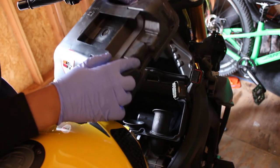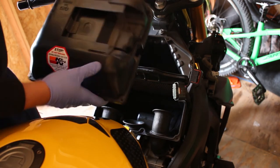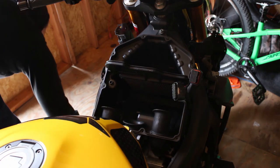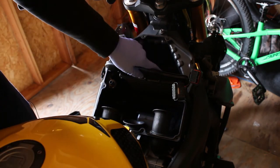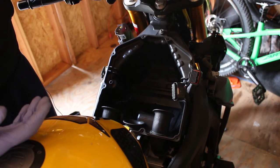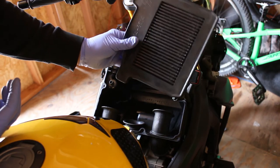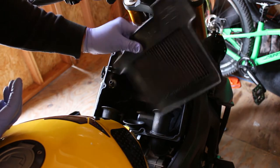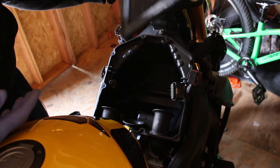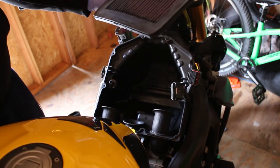Also be aware there's an insert right over here. These two ECU cables are inside there, so just pull them off. And this is pretty much how you access your air box. This is your air filter, and mine looks like it could use some recharging or just cleaning — actually, it's really not that bad. Unfortunately I don't have a recharge kit with me right now, I already have it in the mail coming, so I'll just do this all over again. No biggie.